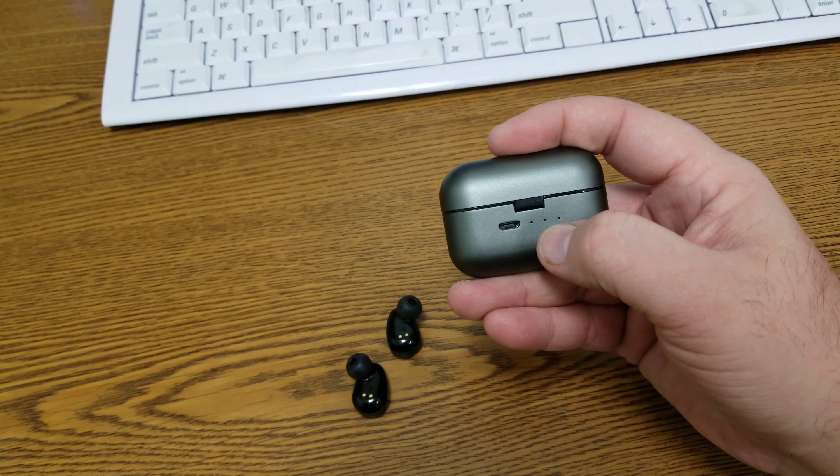They are not charging. One thing I have an issue with in this case is the pogo pins are not that long. There you can see two red lights and a blue light. There are also red lights on top of the headphones when they are charging. You can see that one go from not charging to charging when I touched it. The pogo pins need to be longer — when you put them in, you have to intentionally push down on them slightly to get them to charge.